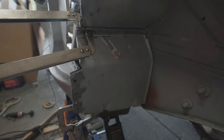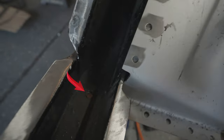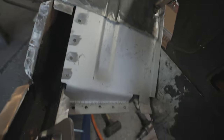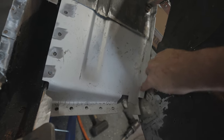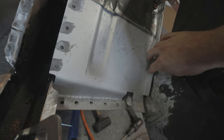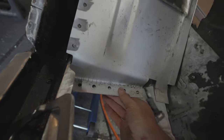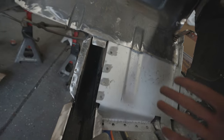This is why this stuff always takes a really long time — it's a lot of bending, hammering, fitting. But getting this to fit right now saves a lot of time in the future. After a day of fiddling with this thing, I think I finally got it in here pretty well. Everything's lined up, the alignment hole is still good. I found I'll need to drill a hole for the drain hole, but all these pieces are lined up, the edge gets hammered flat once we're inside, and after drilling the spot weld holes everything down here is lining up.